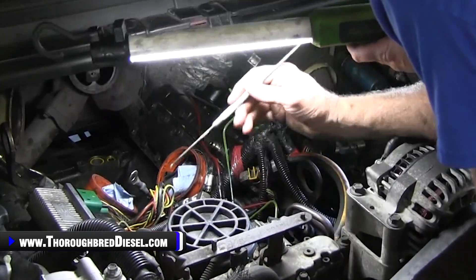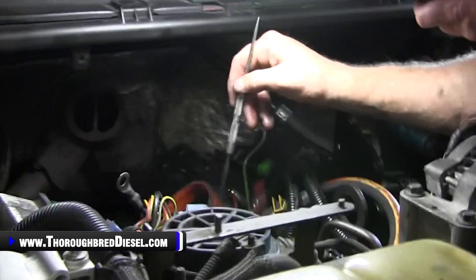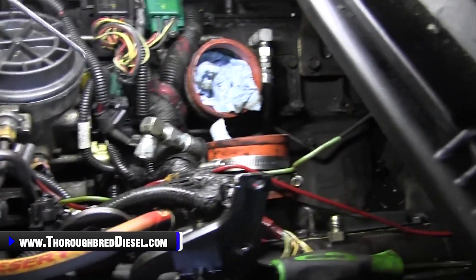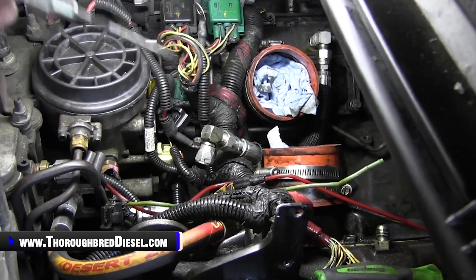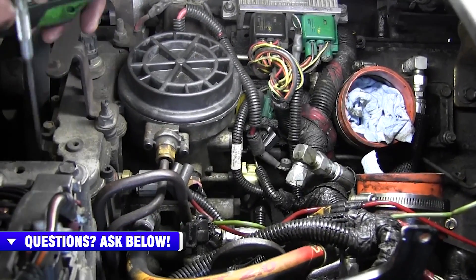Also make sure it's not fuel — fuel bowls can leak. You're going to have some residual oil moisture in the topside of the motor. If you get a fuel leak, the fuel can actually leak into the valley, it will mix with the oil residue that's in there, and it's going to be a black liquid that you're going to see. So you're automatically going to assume it's oil, but it very well could be a fuel leak that's mixing with the oil residue.